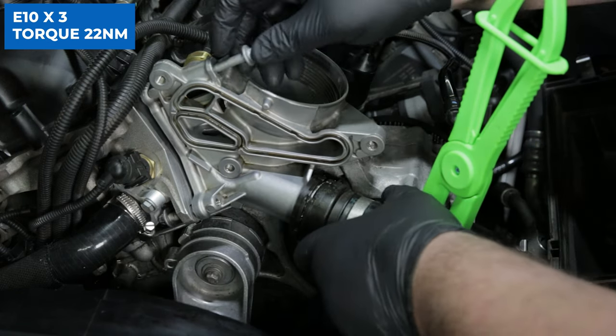Don't forget to reattach the oil pressure sensor. Go ahead and put the filter cap back on so that no debris gets in the housing. Now is also a good time to lock the upper radiator hose in with the clip. Now we're ready to reinstall the intake manifold. It's a tight fit so just take your time and make sure that you don't get caught on any wires or hoses. The manifold gets secured by those five 11 millimeter nuts and two 11 millimeter bolts in the front. Start with the one in the middle first and then work your way out in an alternating pattern. Torque down the manifold to 15 newton meters, starting with the middle and working your way out in that same alternating pattern — this ensures that the manifold gets seated flush. If you unplugged your O2 sensors, don't forget to plug those back in.